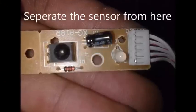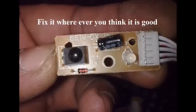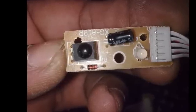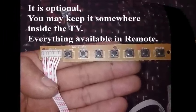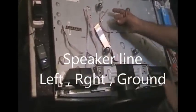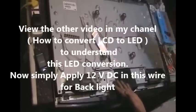You can see a sensor on the right side of the keypad. This is to be separated — you can install it anywhere on the front of the LCD or LED TV. The remaining is the keypad; you can fix it or not — no problem, because everything is available on the remote. Do all this as pre-preparation for installing the board. Now let's start. We are going to install the 5.9 universal board in this TV. This involves the speaker line, LED backlighting wire, LVDS, and keypad sensor.